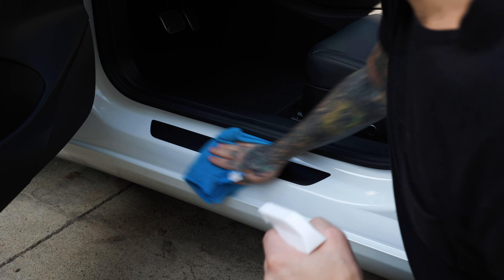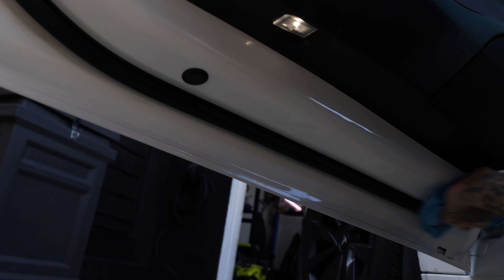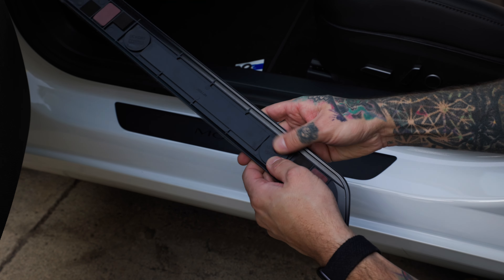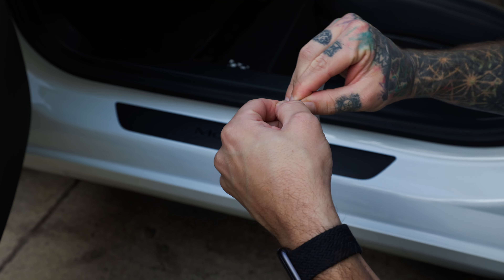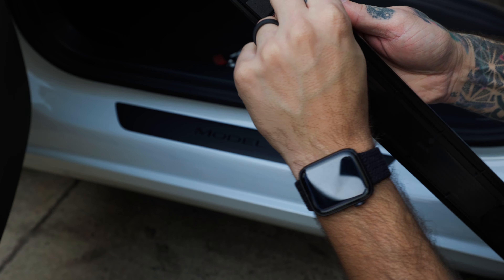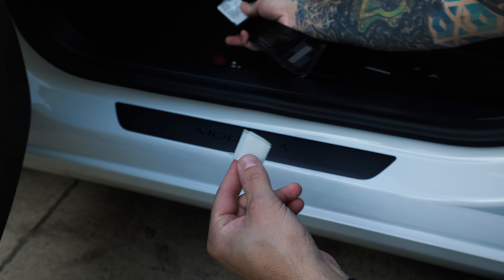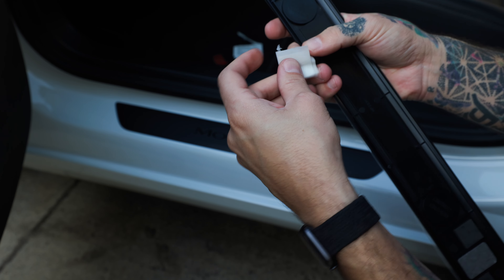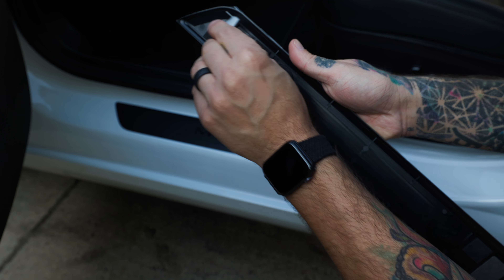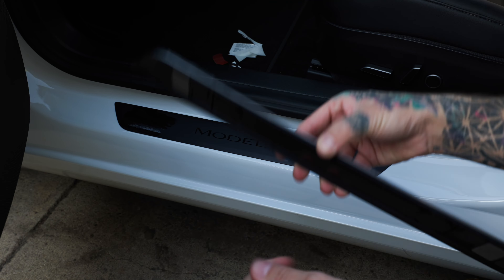So now let's get started. First, you're gonna wanna use some water or an alcohol solution to clean the surface extremely well. Go ahead and clean the current door seals that are in the front, as well as everything in the back and underneath the doors themselves. Then I like to do a test fit just to make sure everything lines up and fits snug. Push down the battery covers to make sure they're secure and peel off the double-sided tape. Once you have everything ready to go, use the adhesive promoter — I like to put it on the double-sided tape itself as well as where I'm gonna stick it. This stuff dries extremely quick, so you're gonna wanna do all the door seals pretty fast or get a couple extra sets of adhesive promoter.